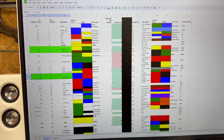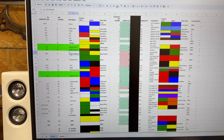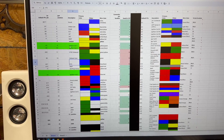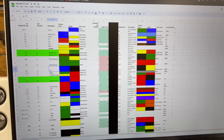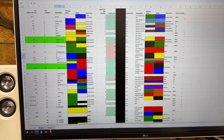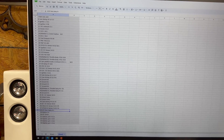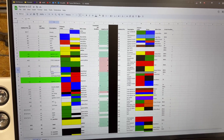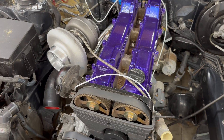I used the documentation from K-Power to figure out what pin goes to what — which 54-pin goes to which Haltech pin — and as I'm terminating the harness I'm marking them green to show they're complete. Some of this will have to be moved around: for example, these two VTec solenoid pins are going to become ignition coil outputs since the K-Power harness is only wired for four coils and we need six. I'll post a link to this spreadsheet in the description. Staying organized and documenting what you're doing is the most important thing when it comes to wiring.